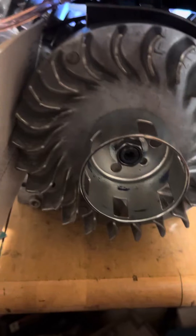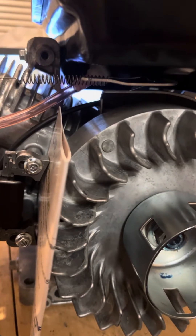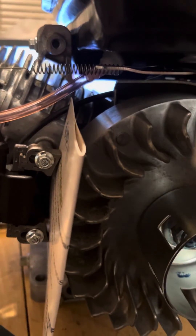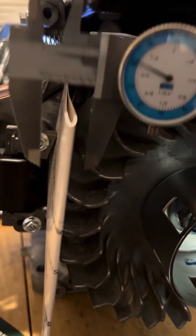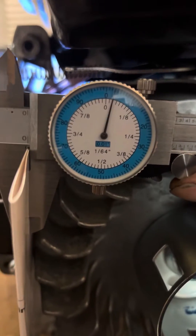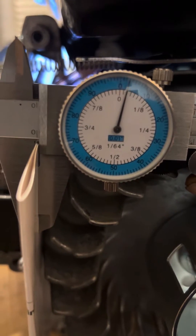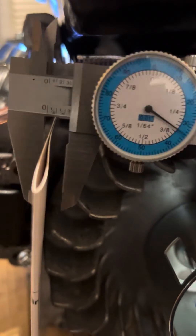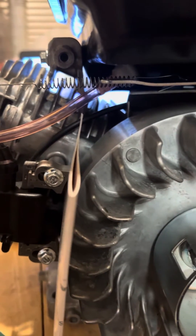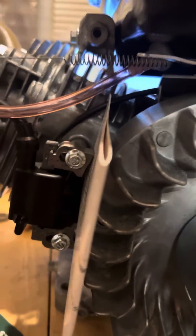What I like to do is get a sheet of cardboard — an old mailer works really good. When you double it over, these are kind of a fractional caliper, but doubled over it'll give you 30 thousandths, or a 32nd of an inch. All you have to do is slip that in there between the magnets on the coil.